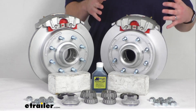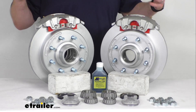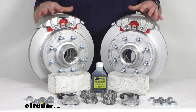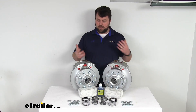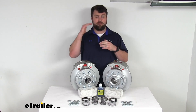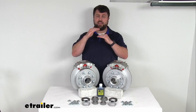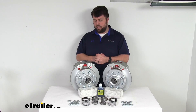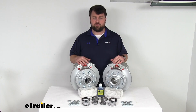Having that dichromate finish on our hubs, rotors, calipers, and our caliper mounting brackets is going to offer excellent rust and corrosion resistance. It has a salt spray rating between 300 and 400 hours, so these are going to be great for your boat trailers and trailers used in coastal areas or on heavily treated roads with a lot of salt contact. If you're looking at a good, better, best scenario, the very best is stainless steel construction, but these dichromate finishes are just slightly underneath that — a major improvement over unfinished hub and rotors and even a little bit higher than your E-coats. Definitely a good way to go for really corrosive environments.